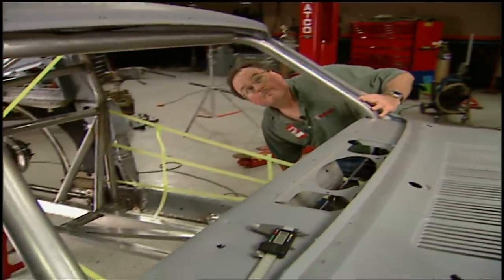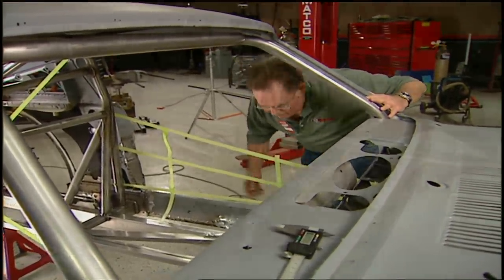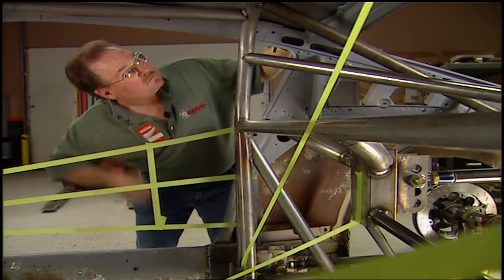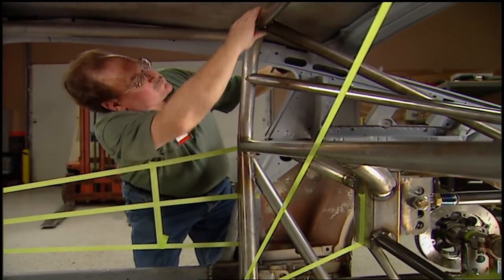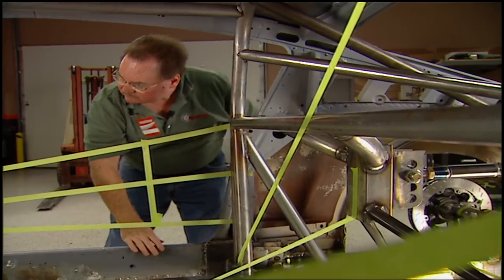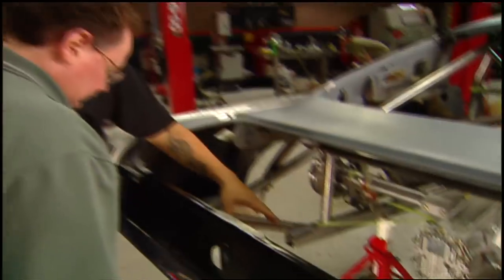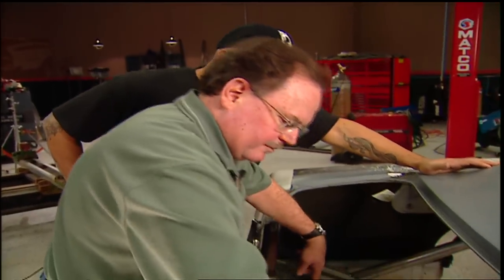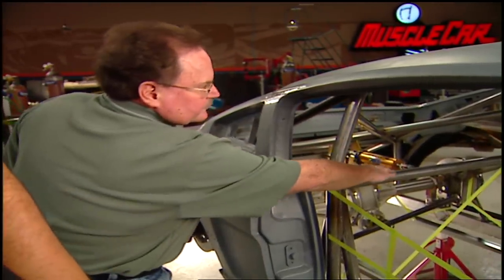Phil's main concern is safety — looking for the structural integrity of the cage, making sure the welds are good and not pitted, checking the fuel cell, the firewall, and the overall componentry. I just wanted his opinion before I welded it all up. It's time to pick his brain for things like fuel cell requirements. You've got to have a frame for your fuel cell, something across here for more side impact bars, as long as it stays in the same plane as the main hoop and is horizontal. Additional bracing — triangulate everything — and more common sense.